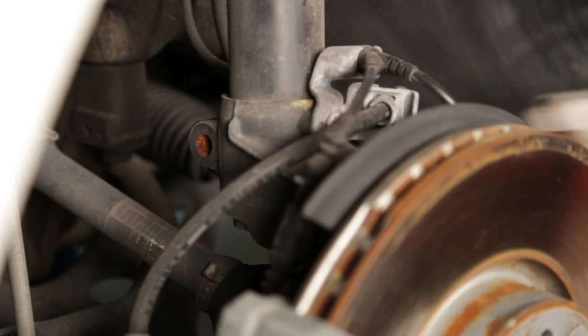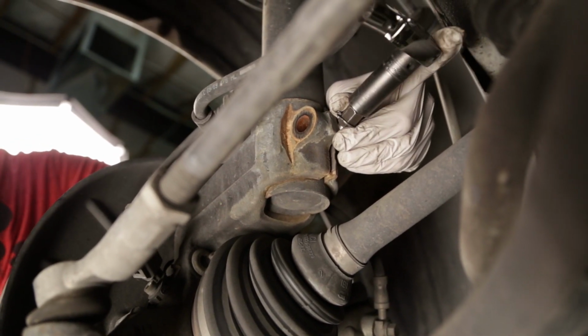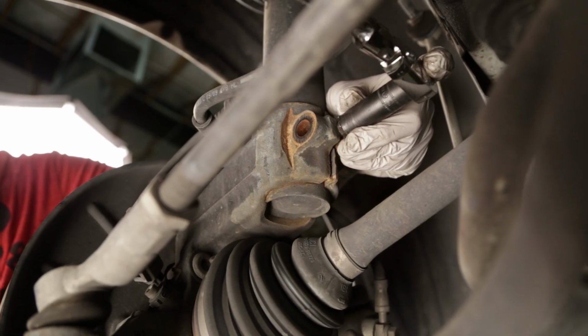To free the strut from the hub, you will need to use the Raceland strut spreader tool to spread the hub enough for the shock to come loose. Insert the tool into the spacing into the hub and twist to spread the hub apart.